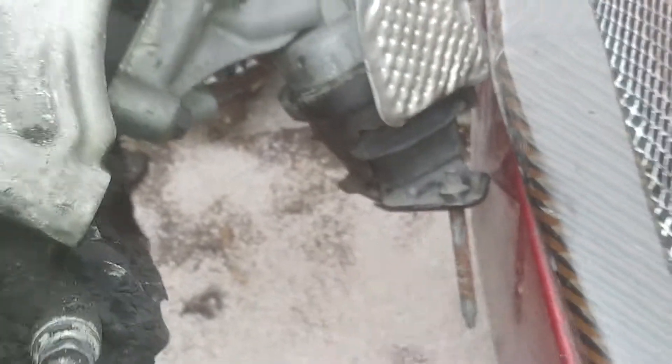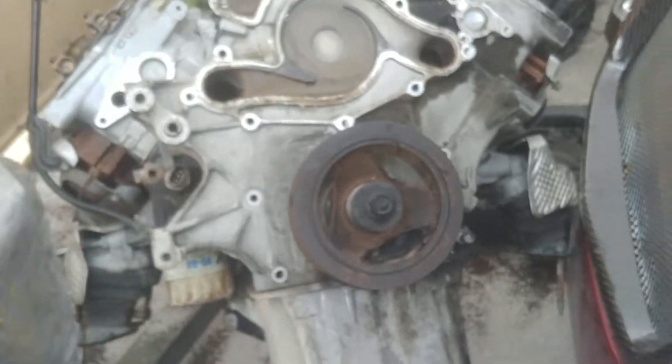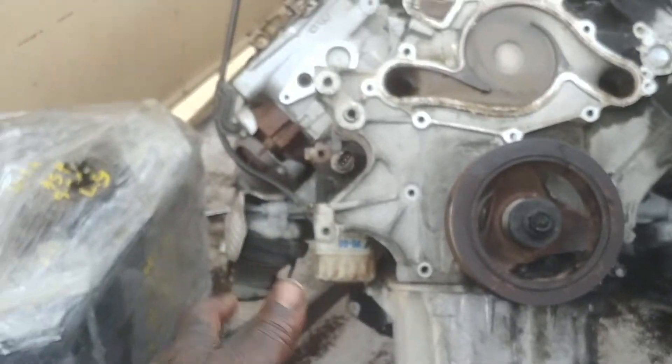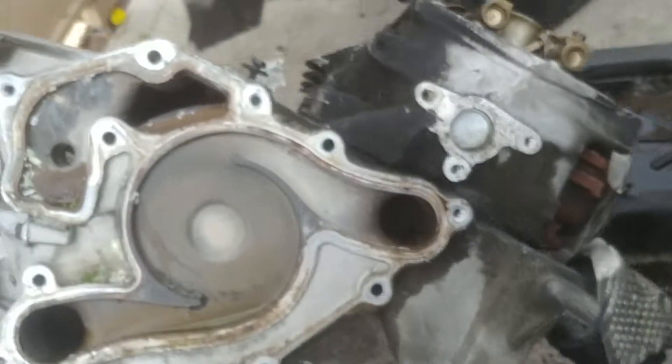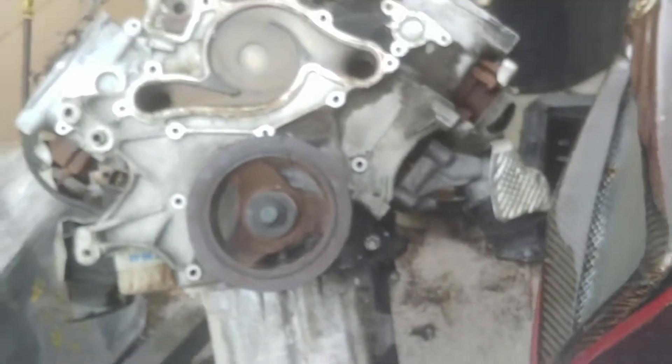I also need to get oil and an oil filter. Motor mounts are thrashed, and I need to get a harmonic balancer puller so I can get that off. Then the whole plate comes off, the oil pan drops down, and I take the manifold off. Motor mounts — that's all that comes off the block to be bolted onto the new one. Then you build on top of the motor, and you already know the rest: smog pump, AC, starter, alternator. That's it.